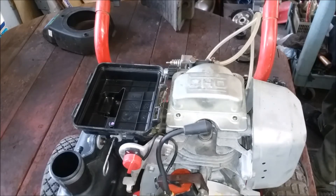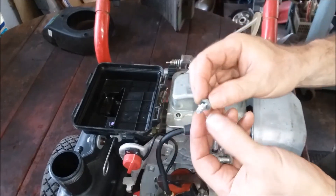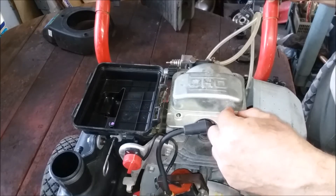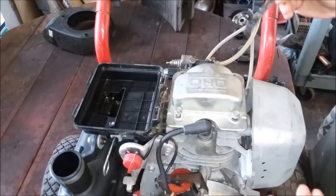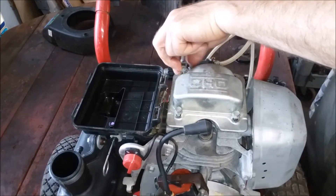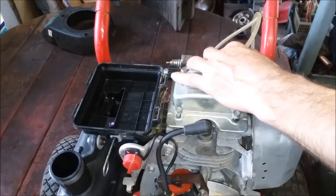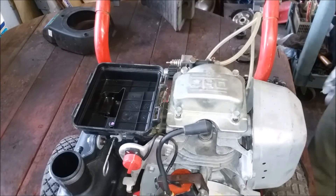I like to put a little bit of oil or anti-seize on these threads — these are cutting threads, so they're used to kind of cut their way in originally, but once they're in you don't want to damage the threads. Just put a dab of oil or in this case a little anti-seize. Make sure they go in straight because they'll cut their way in and then ruin the threads that are already there. Just snug it and we'll come back. You can heat the motor up, do a quick test, or if enough time goes by before you start the motor you can snug them a little tighter. The key factor is don't over-tighten it.